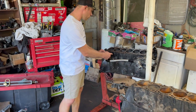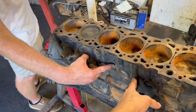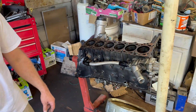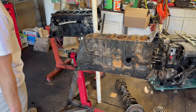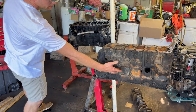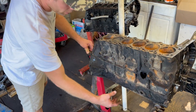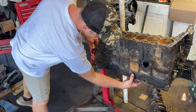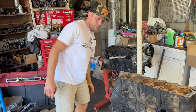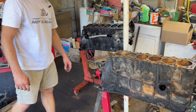Another big difference: there are two oil passageways right here — I'm guessing drains from the cylinder head. There are only two on the 603, but on the 606 every single space in between has them. The blocks also look a little different here: the 606 has a smooth block, while the 603 has some ridges — strength ridges maybe. I'm wondering if the metal thickness of the block is different; it feels about the same, but really interesting how the 603 has these ridges and the 606 is just smooth.